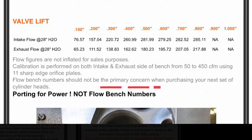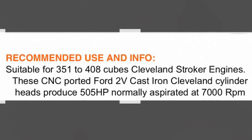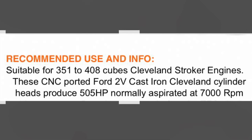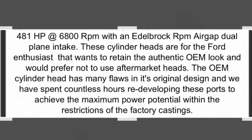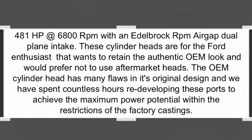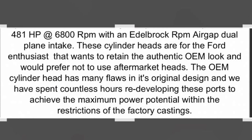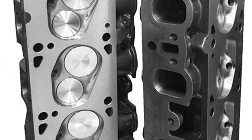There's some chamber reconfiguration on these heads. This is where they top out — basically good for around 280 CFM worth of flow, which equates to about 500 to 510 horsepower worth of flow potential. A lot of people don't realize it takes a serious and stout combination to make 480-plus horsepower out of an iron 2V headed Cleveland. If the head's not there for it, it's going to struggle to make power gains. The 2V head just seems to bottom out around that horsepower and flow mark regardless of which head guru you take it to.